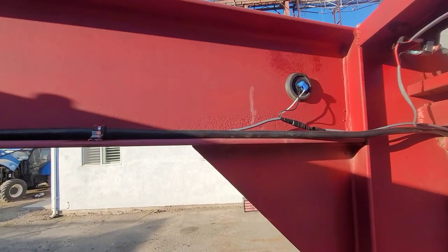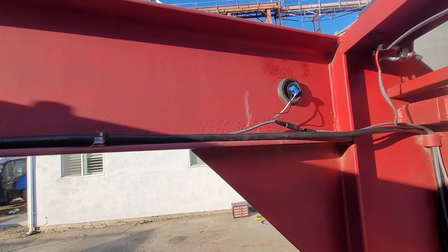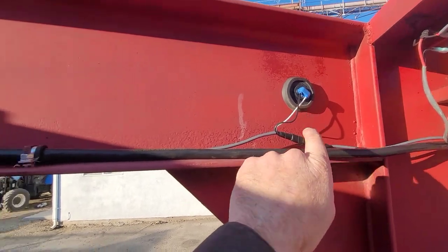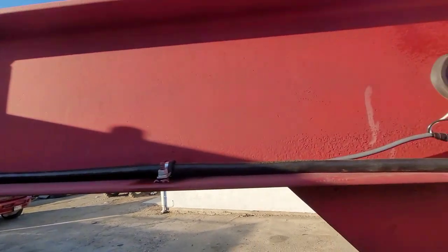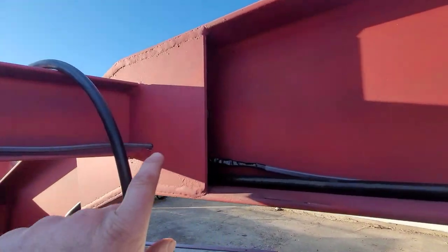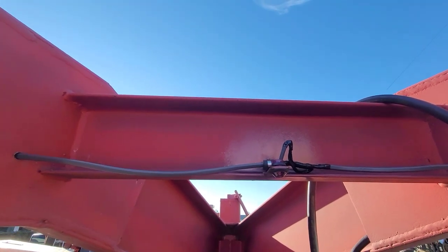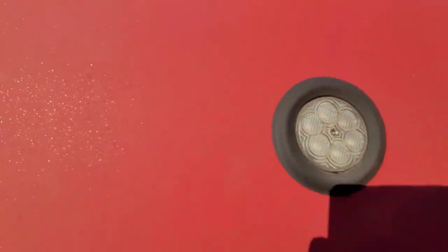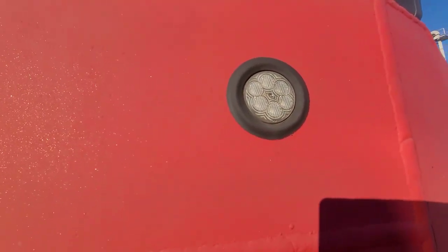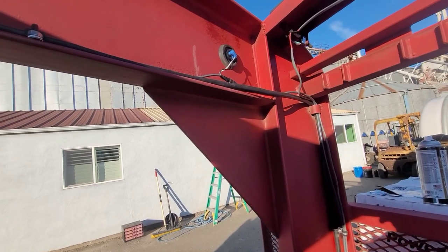Now this is something that we do, for whatever reason, I don't see it as very common in other trailers, but we put lights up in the neck. So I've got a 2-inch round there, got a 2-inch round in there, same thing on the other side. And so you can see where I ran my cord, my 2x14 comes across. There's my purple light right there, my bullet light. And there is the Maxima Clear ambers on the outside. So that covers getting the clearance power up here.